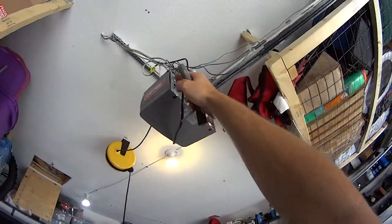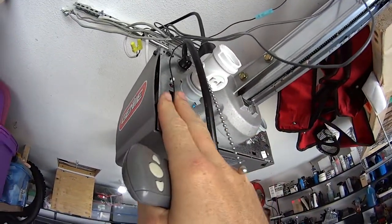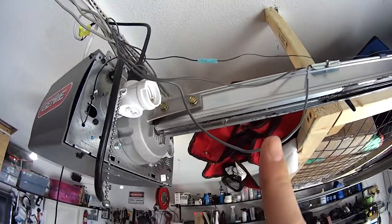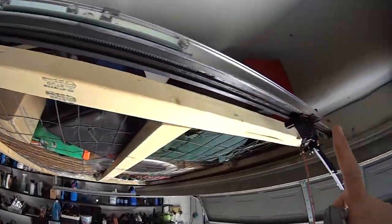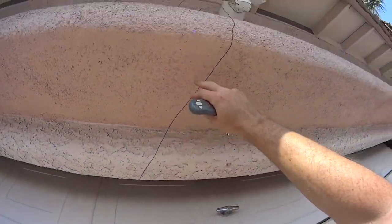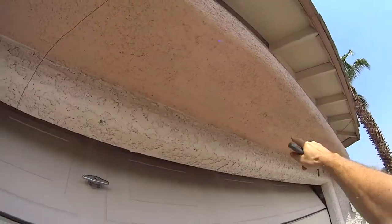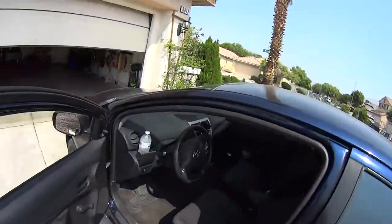There is a little wire on the opener — you see this little wire? Every garage door opener has it; it's just an antenna. But it stopped all the way over here, which was just too short. So what I've done is added another wire to it and brought it all the way to the outside. Right now it's not arranged neatly — I was just testing it, wrapped around my lamp over there — but I'm going to make it look nice, maybe run it over here somewhere.